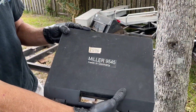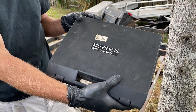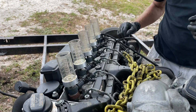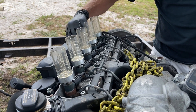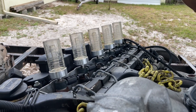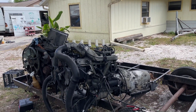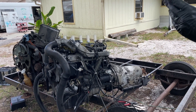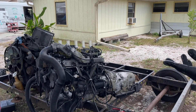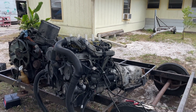Miller 9545 — made in Germany. Miller specialty tools; I have a modest collection of those, a little more than your average shade tree mechanic. The cam sensor is unplugged so the engine won't start. Ideally we'd do this test when the engine is warm, but if the engine won't start it's hard to warm it up. What we want is a little bit of fuel in every vial, but more importantly it should be equal across all five cylinders. If one is excessively spitting out fuel compared to the other four, that one has a high return value and is going to fail injector testing. Let's crank it up and see what we get.